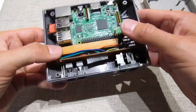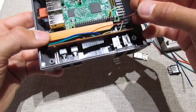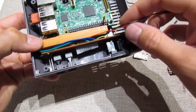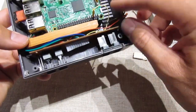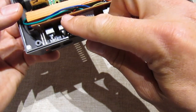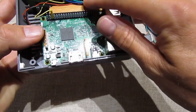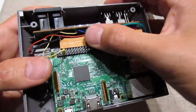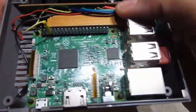Be aware if you're going to do this mod and you connected the buttons as I did before — you need to disconnect the ground and the power cable for the LED, otherwise I think you'll burn the GPIO. What I did is I routed the USB here and added the power where the original power used to be. The 5 volts from the USB is added to this connector over here, and then I just routed the other signal wires. I could show you a picture of where to add all the connectors.